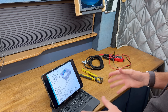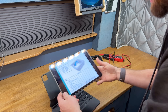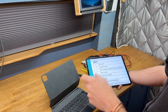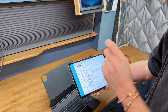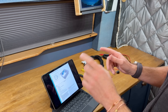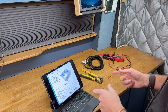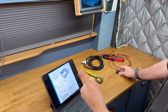Next is to disable smart regenerative charging on my alternator. There is a correct way to do it for Fords. On my van there's a feature called smart regenerative charging inhibit, which works in a number of ways: one is if you have the eco button and hit that — it stops the start-stop feature as well as smart regenerative charging. I don't have start-stop on my van, but it still works. The other way is using the interface connector. I've got a pre-facelift 2018 Mark 8 Transit with an 8-way connector; newer versions use a 10-way connector but it's still got the same pin. To use the smart regenerative charging inhibit feature, it needs pin three — the signal pin — to be grounded to the vehicle chassis, and pin one on the connector is ground.